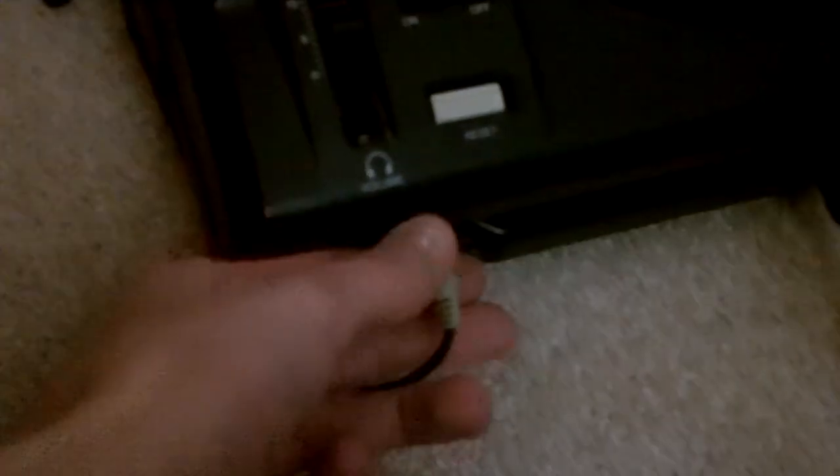It was about $4 from Amazon. And also, if you have the Sega CD and you want to get the full stereo sound, what you're going to want to do is take the audio out on the front, turn the volume all the way up to 10. You may need to clean out this port — it kind of wasn't working for me very well, and neither was the volume knob. So you just use a regular headphone cable, run it around to the back of your Sega CD, and plug it into the mixing port. Then just use the two audio out plugs into your audio in on your TV, and you'll get the sound of the Sega CD in stereo as well as the sound from the Genesis.